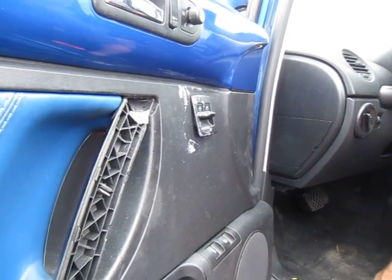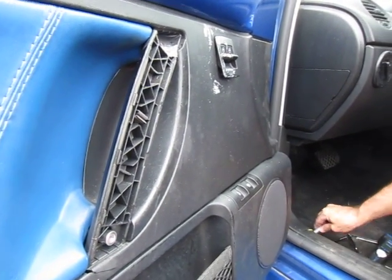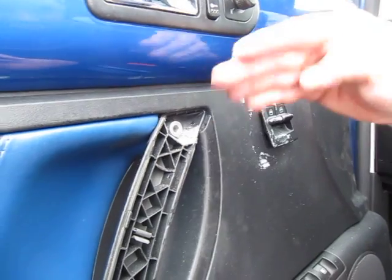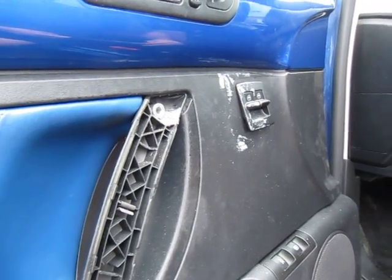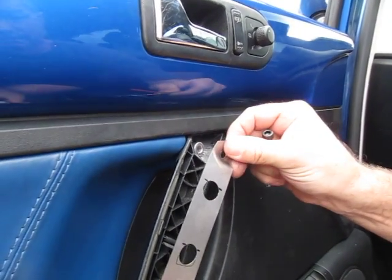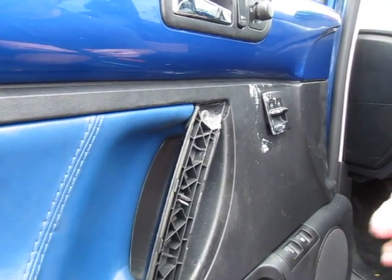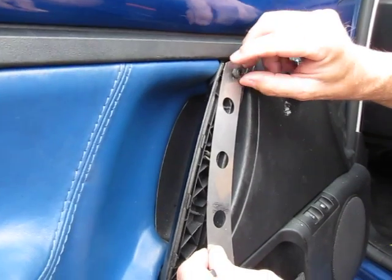We're going to go ahead and install the spacer tube into the bottom hole. And we're going to carefully slide the upper spacer tube above the JB Weld so it doesn't get in the tube. It will set down in the JB Weld, and that's fine. That's what we want. I've already bent this. I'm going to use this newer one here. Go through. Thread it in by hand.